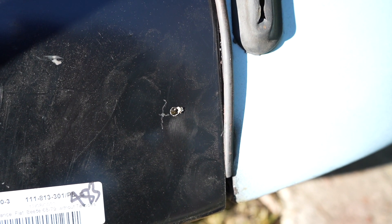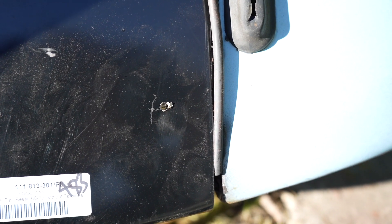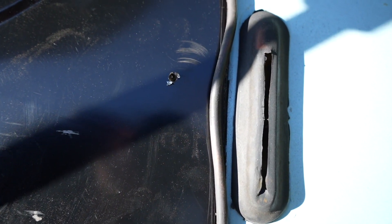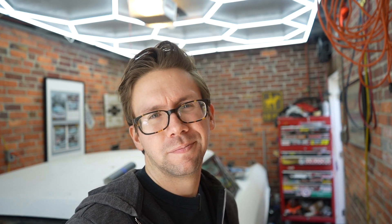I know you want to drill a three-quarter inch hole right away, but hear me out — drill an eighth-inch hole first and put your panel back on. Take a flashlight and look around in there to see if you can see the stud. If you can't, you've got some tweaking to do, and now is the time to do it with an eighth-inch hole rather than a three-quarter inch gash in whatever panel you're working with.